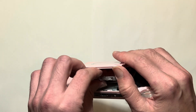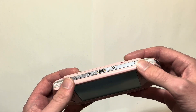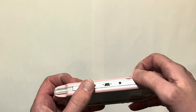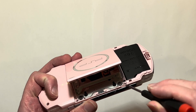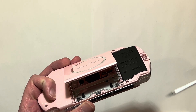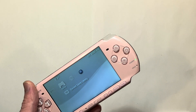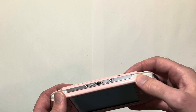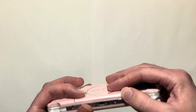If you don't get any startup attempts at all, even before trying any of these methods, you could have a broken lever or broken pin. The pin could be bent to the side — it has to make contact with this point right here, so if it's physically broken you will have to solder on a replacement.